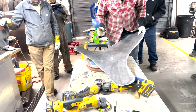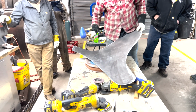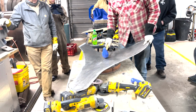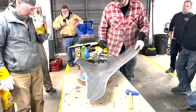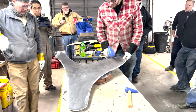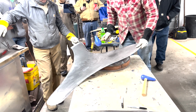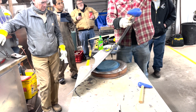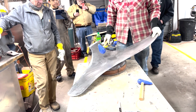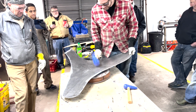So again, if you don't do this, things can look a little bit flat. Now, can you guys see already that it's shaped and giving it a little bit of dome? Now, a lot of this has to do with how hard you hit it. I need less curvature in the back edge of that roof, right? I need more up in this corner. So that's what I'm doing here.